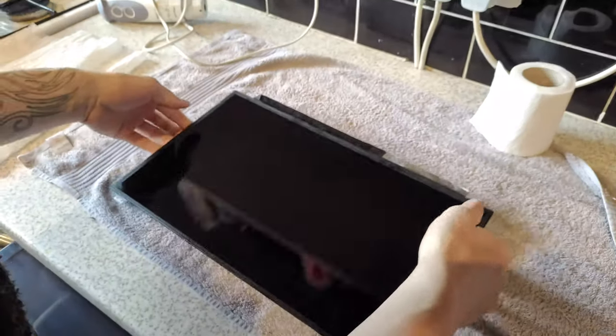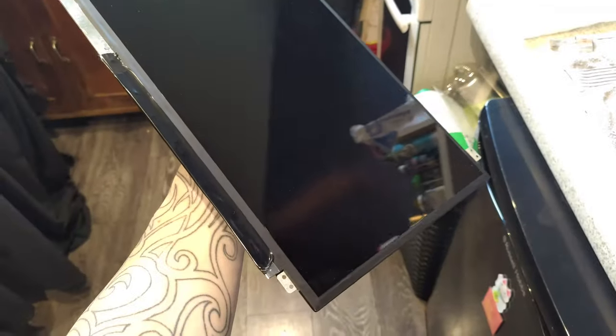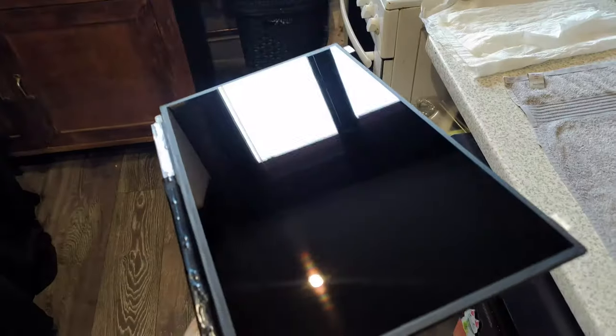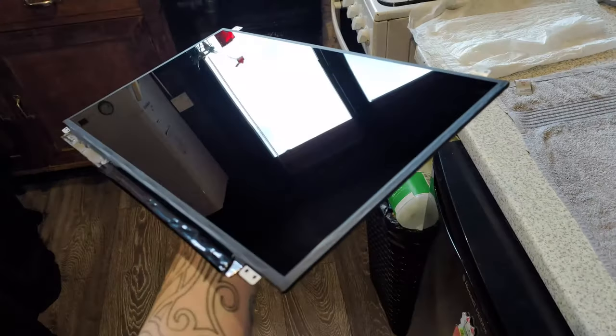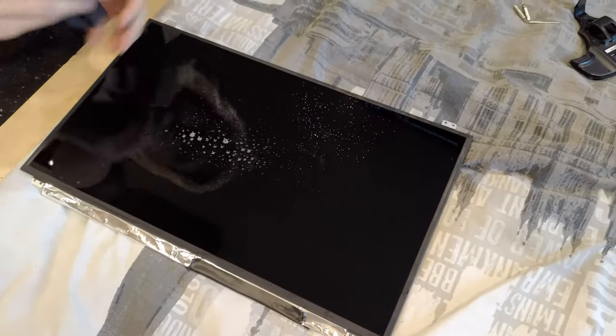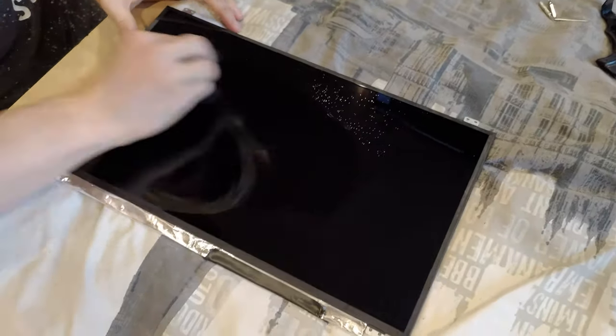Now we may have the anti-glare layer off. That is not the final step. Actually, you can see this panel is already attracting a lot of dust and it doesn't actually come off easily, so now we just need to remove the excess residue. That's what it is, and we do this with some glass cleaner. That's what, at least what I use.